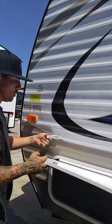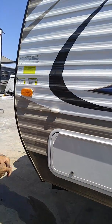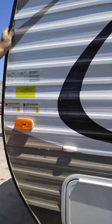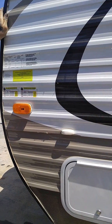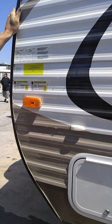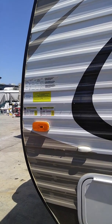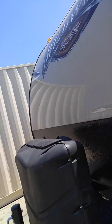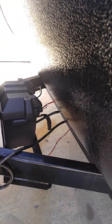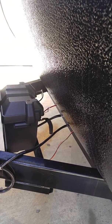These do hold up your doors. When you get your set of keys, you can lock it all. There are more specifics — PSI of your tires. Usually the max PSI is 50; you want to have it about 45 for the fluctuation of expanding. You go in different altitudes, rubber's going to expand differently. All of that is also in your owner's manual. And there's a battery back there — that's your battery. That's going to control basically everything you need. If you're not plugged into your power, it's going to control your awning and your slide-out.